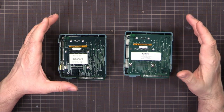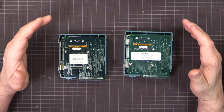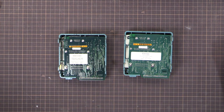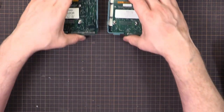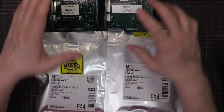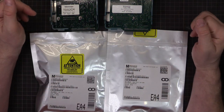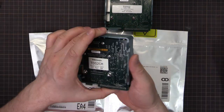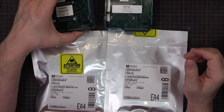You need a couple of things, and I'll show you how to do it. And if you follow along, you can upgrade your unit from a CM to an MM as well. So first up, we're going to need a few components. You need to flash the MM firmware to a new chip, and then replace the one that's in here. It's just a plug-in PLCC chip, I believe.